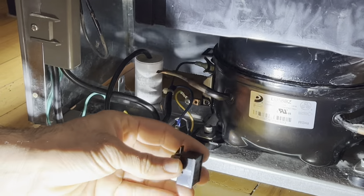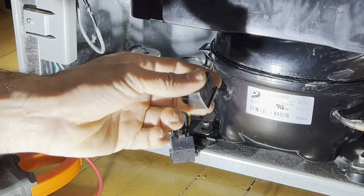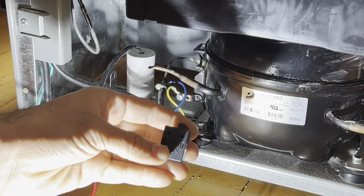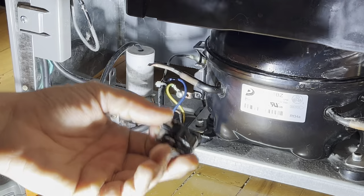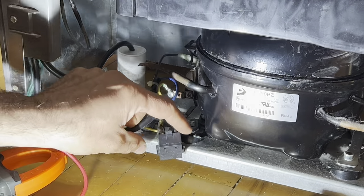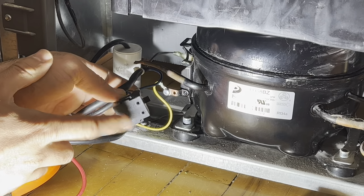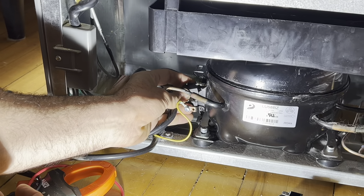The second way to test this relay — if it's good or bad — you just wiggle it with your hand. Can you hear that? It has a little small ceramic disk inside. That disk breaks over time and then it doesn't work anymore. If I move the new one back and forth — you see that? No noise. So the ceramic disk is perfectly fine inside here. I'll reinstall it back in — the pins are going straight there.